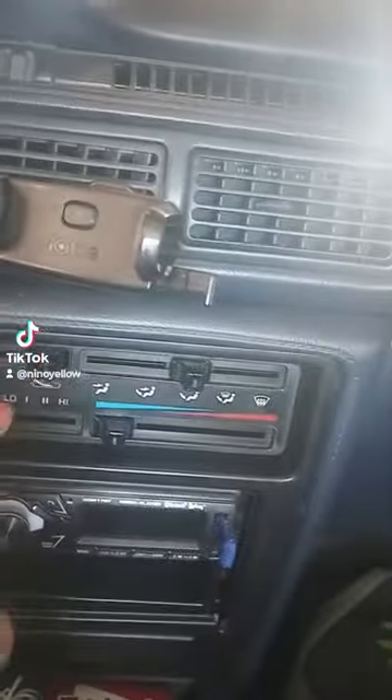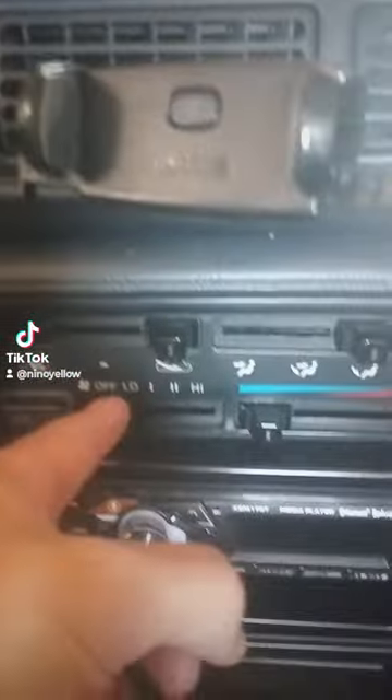This episode my car is absolutely falling apart. We're gonna do all kinds of stuff - my air conditioning including the blower motor just cuts out at random, so I'd assume I'm not getting power to the control panel. I'm gonna take all that apart and see if there's a loose ground wire, because it'll cut back in every once in a while.